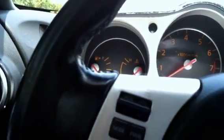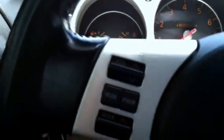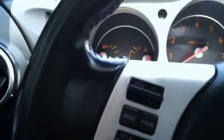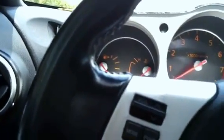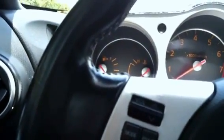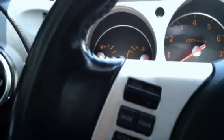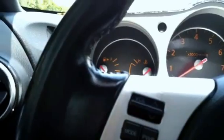You may need a helper because it can be hard to hear the throttle sound from inside the cabin. For the idle air volume learning, it's much better to count time accurately with a clock. After performing the accelerator pedal release position learning and throttle valve closed position learning, proceed to the next step.